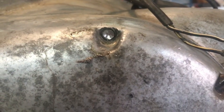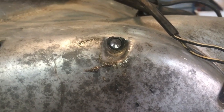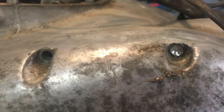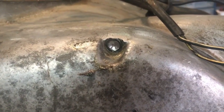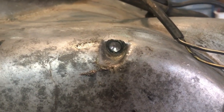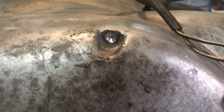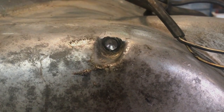Okay, so this is what we want to end up with. That's a drilled crosshead. The head has come off. There's the head that we've drilled through and then tapped off. So the case now should slide over that, and once the case is off, it's just a case then of clamping something onto that and unscrewing it. So we'll do that to the other three. I have got some left-hand drill bits too, which are quite handy. Sometimes as you're drilling away, if there's enough force, you can actually encourage a screw to unscrew, so I do use those too. So I'll get on with the other three and I'll bring you back once those are done.